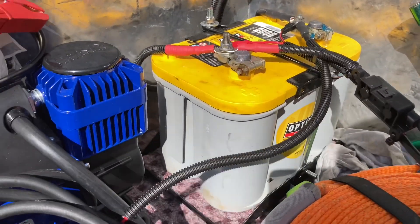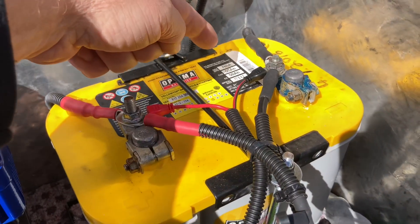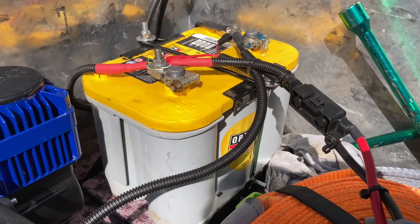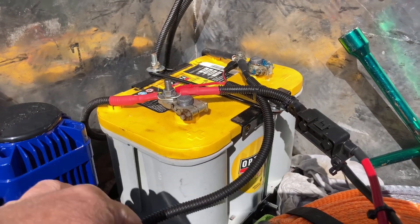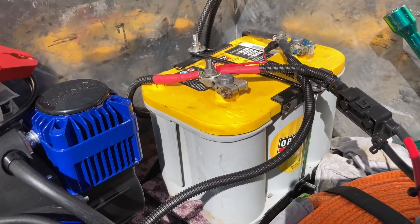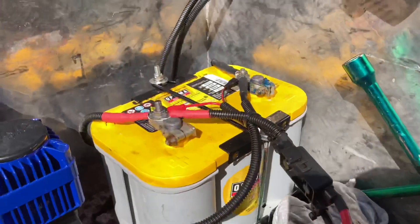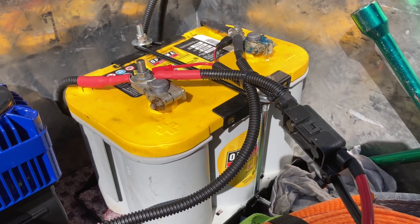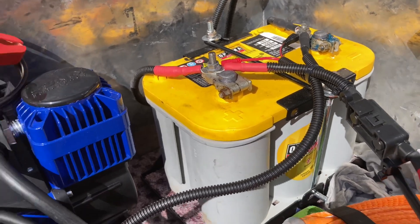In the toolbox here - we're out in the sun, sorry about any reflection. You can see the battery. I think it was a 2016, it says over there - about six years old. It sits in here, it's regularly got the compressor connected to it but not switched on. It's got the charge wire for when I want to plug it on the charger, because we have got a charger connected here. This was down to 12.3, 12.4. Now let's go to the back of the 120.